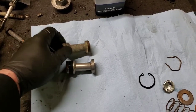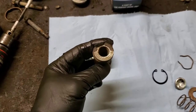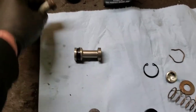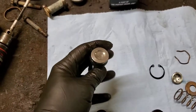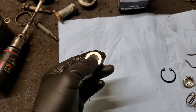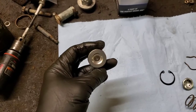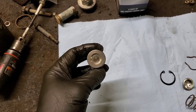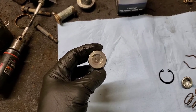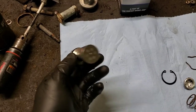The only difference we did have to address: the original piston has a hole in it for the original pedal push rod to go clear down inside the piston. The replacement piston from the kit originally just had a dimple in it to the depth of the angled chamfer area. My friend Joe had to bore this out to diameter and to depth to make it work for my application, but I think it'll work great. Thanks, Joe.